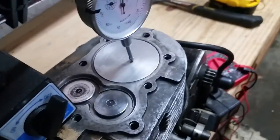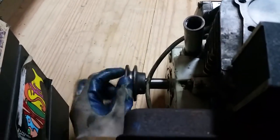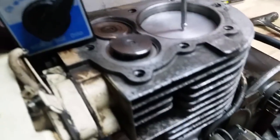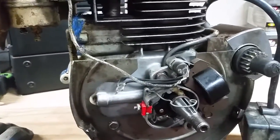One thing you want to know before doing this is the rotation of your engine. You can find that out by looking at your blower and figuring out which way it needs to turn, then relate that to the engine itself. This Tecumseh rotates counterclockwise if you're looking at it from the pulley side, and clockwise from the flywheel end. That's something you need to know because you want to set the timing of the contact point according to the specifications of your particular engine.